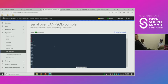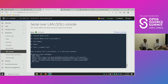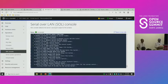I'm currently connected to the serial console of the host. You can check what's going on at the BIOS level and the ROM level. In this case, the ROM integrates a UEFI shell and a Linux kernel — that's the Linux Boot implementation of a ROM. There is also a user space integrated with that Linux kernel called Uroot, which is a Go-lang based user space. There's probably no bootable image, but there is everything set up to boot the systems. It's resetting now because there is an automatic timeout — you can see the Linux kernel coming back.